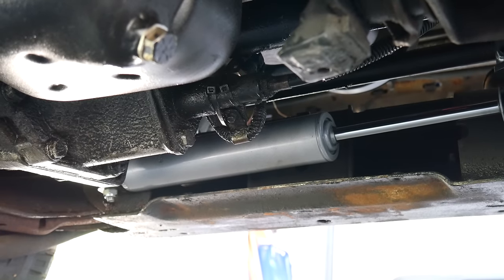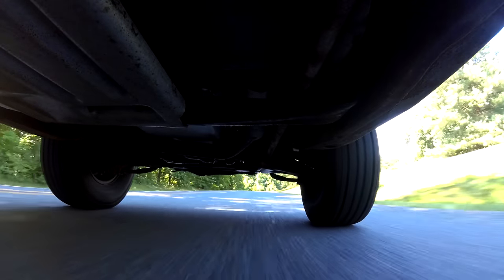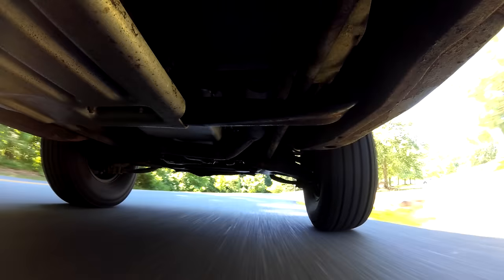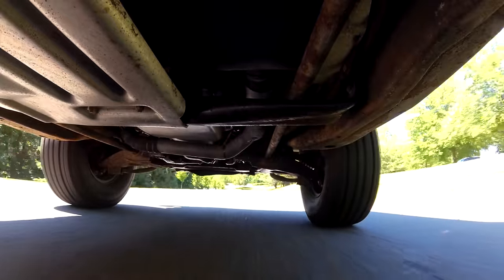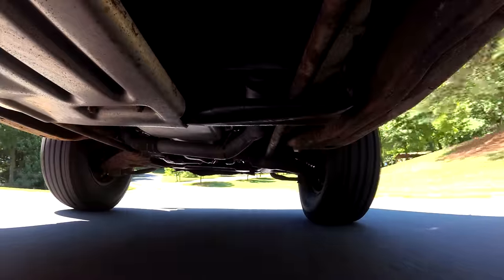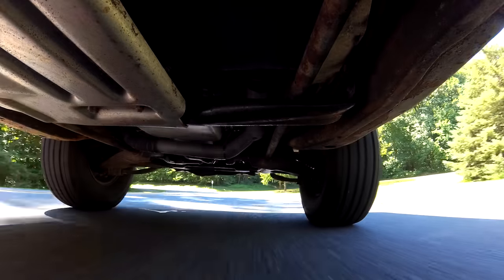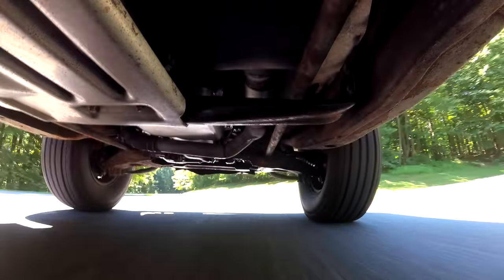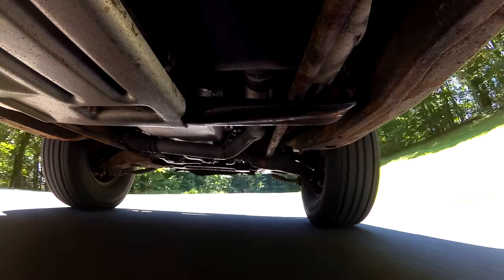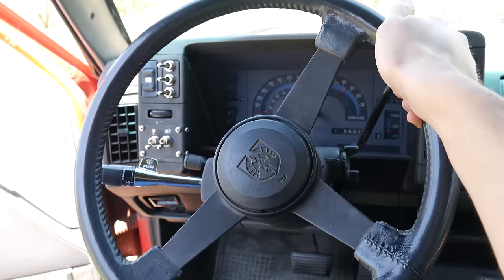So now that I feel okay about that, we'll go ahead and take it for a drive. After driving with the stabilizer for a while, it definitely did help. It really did smooth out the steering and remove a lot of bump steer. It does still tend to wander and want to tramline on certain road surfaces, and a certain amount of that is probably down to the tread on the tires. But with all the work we've done, I'm convinced it should be better than it is. Other than getting a proper machine alignment and having the caster checked, the last remaining link is that intermediate steering shaft. I'll be looking for one with solid U-joints to replace the rubber one in the future.